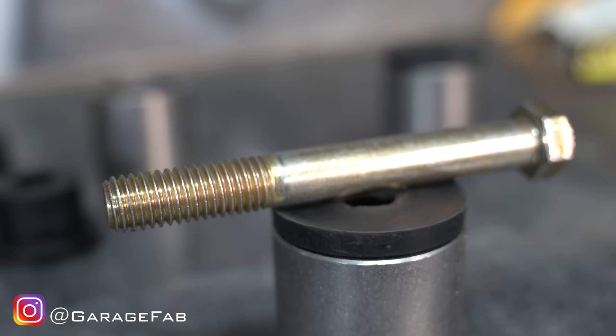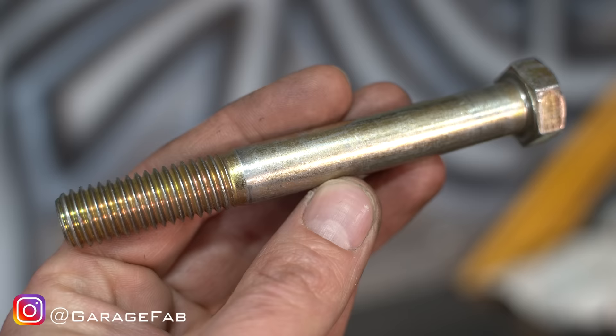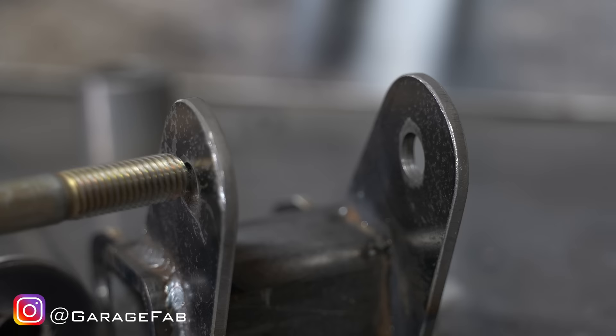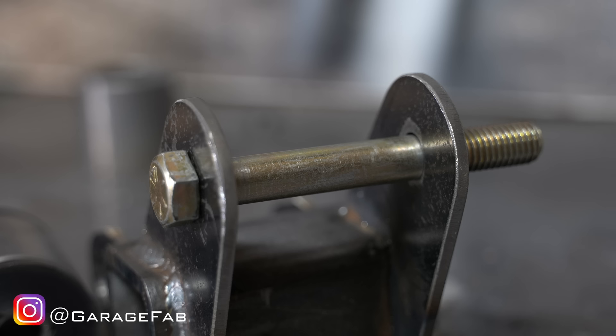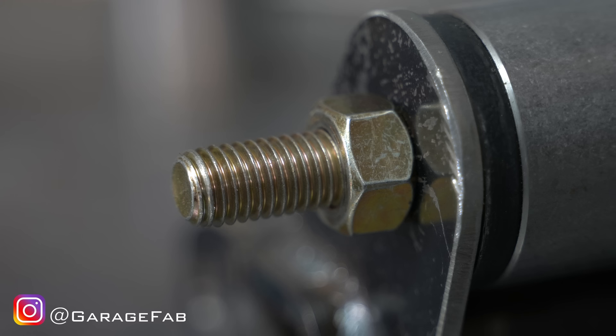That's really not good. A brief side note on bolts: I always use grade 8 bolts on link bars, usually 9/16-inch bolts. My reasoning is simple — this is equivalent to the size bolt that Toyota uses on their link bars and control arms. I once learned from Max Fish that the shank of a bolt — this unthreaded part — should stretch the entire distance between the link bar tabs. The reason is a bolt is more likely to break in the threaded area, so you should purchase a bolt with a shank long enough to span the width of your link bar tabs. This means you will likely have excess threads sticking out that you'll want to trim off.